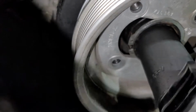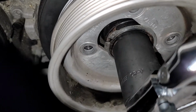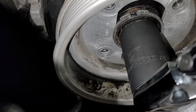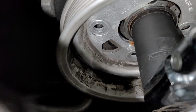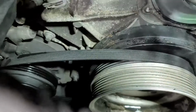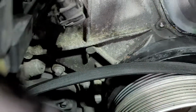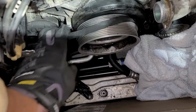Okay, this should be quite exciting. And there you can see the snap ring that hopefully is going to hold that pulley on. There, you saw it move some already. Well, a bit anticlimactic, I suppose, but it looks like it has worked as advertised. And there you go. That is one loose AC compressor belt, per the book.